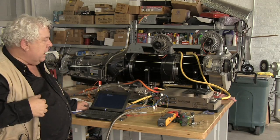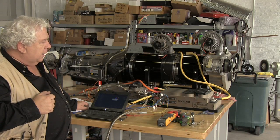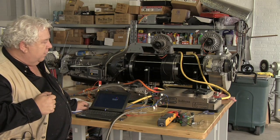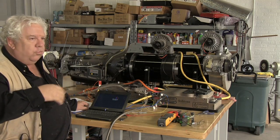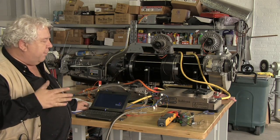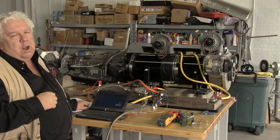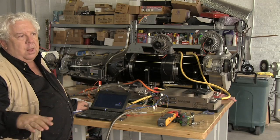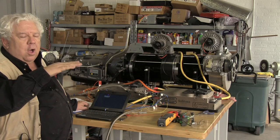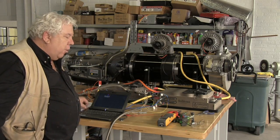at 8 or 14,000 times per second, it can do things much faster than we can imagine them. And so when it gets down to the 160 volt level, it simply cuts back the current. Well, when it cuts back the current, that takes the pressure off the batteries and the voltage rises. So then it can apply more current. And so what it does is winds up effectively holding it right at this cutoff value. And that limits the power output.